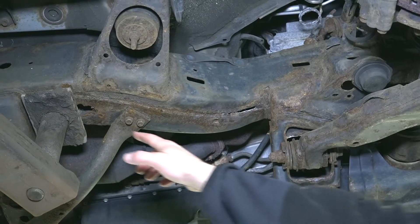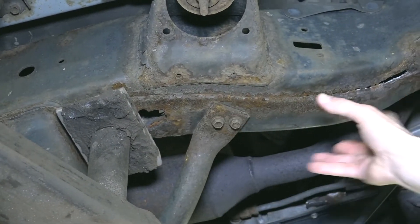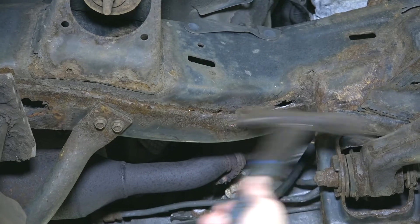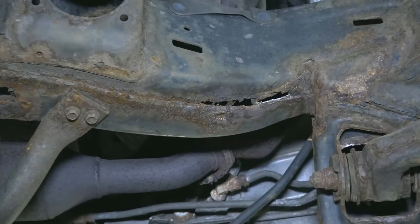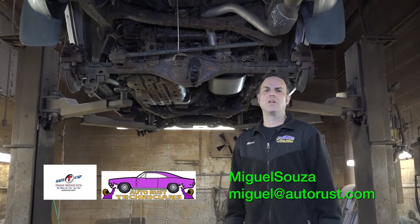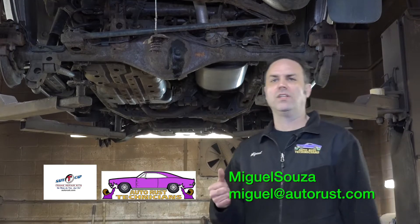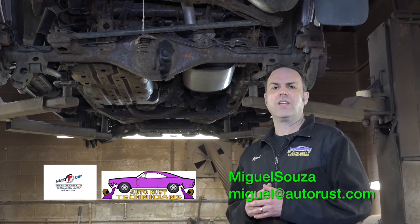Now we're going to work our way up to the front of the vehicle. You can see a big hole right where we mounted it — this is the front frame here, and that's just as bad. What happens is the water gets caught in these areas and just stays in there. Rust and rot is a real common thing on the 4Runners, just like the Tacomas, Tundras, and Sequoias. The bodies all really hold up, but they just have bad frames — so that's what we're going to take care of today.